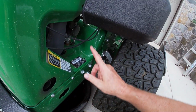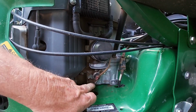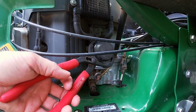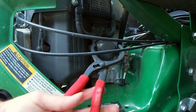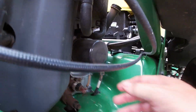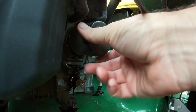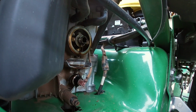So now we'll get back to the oil change, and the next thing we need to do is we'll go ahead and pull the oil filter. All right guys, so right up above where the drain hole is the filter on the side of the engine. I usually do hand tight, but as it gets the run time on it, it'll usually vibrate a little bit tighter. So it usually takes this just to break it loose, which is no big deal. And so you just do a couple of turns to get that worked loose, and then you just spin it off. Now you're gonna have a little bit of oil mess, can't be helped, but if you spin it off as quick as you can, then turn it up, you'll be fine.